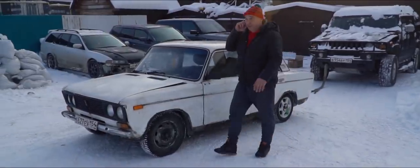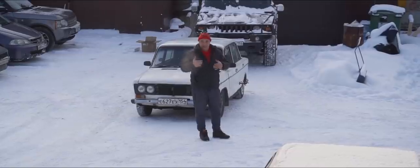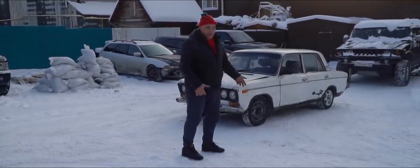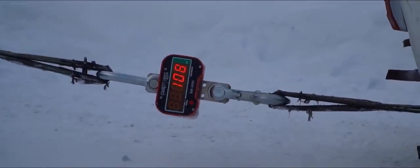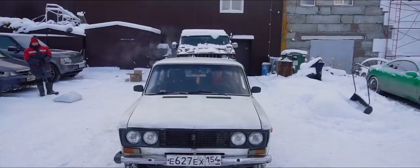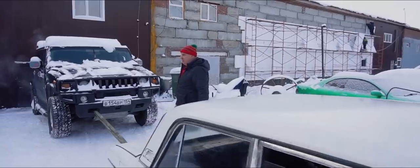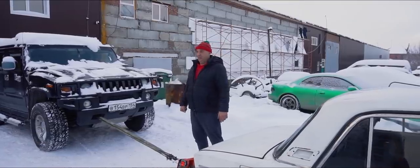That's it. You saw what just happened — that hill is pretty hardcore. If you stop mid-incline, even on a welded diff, the car seems to move forward if you're being careful, but then all you get is wheelspin. That's a tough climb. Now let's check to see how much pull that is in kilos. The wheels are spinning; I'm forced to press down on the gas a bit harder since the carburetor tuning isn't spot on and the car stalls at low RPM — though it does pull nicely. How much was that? About 156 kilos. The car is pretty much empty, no load, and it pulls 156 kilos.